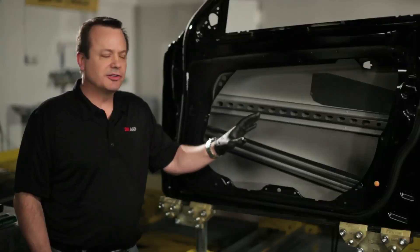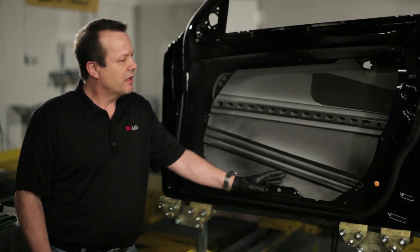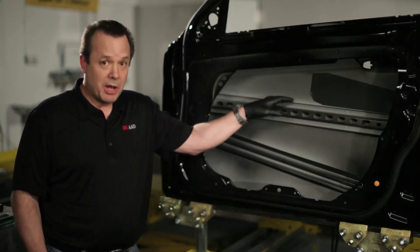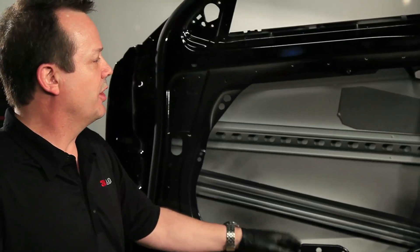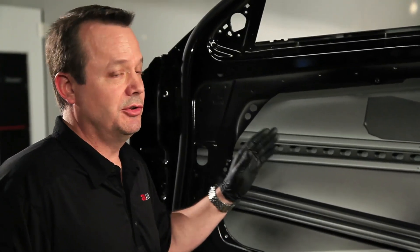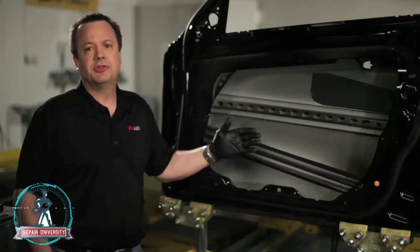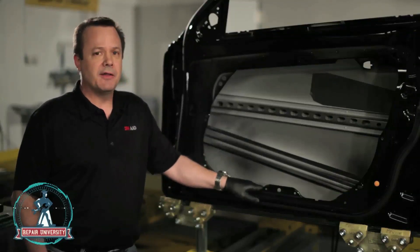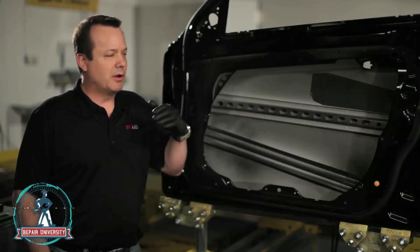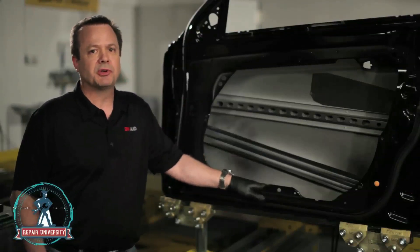We're here to discuss some issues with applying foams to door skins. It's a common operation in the body shop every day, but there's a lot of confusion about how to handle applying the foams once the skin is attached to the vehicle. One thing we want to make sure we do is use the correct product or the correct foam. Some technicians may just grab any seam sealer off the shelf, and you may have problems with that. Some of these products have solvents that allow the product to shrink down, so whatever product you're using, make sure it's 100% solids.